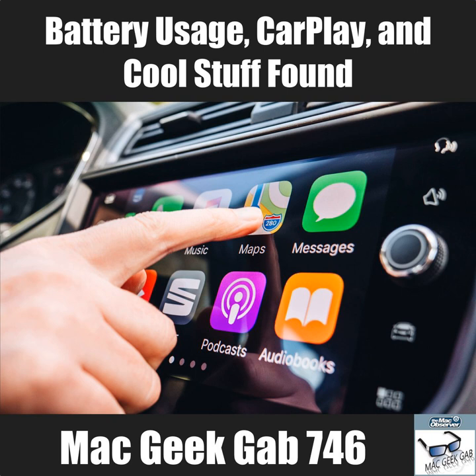Dave discovered an issue: the phone will not connect to CarPlay if it has an active Bluetooth connection where it's sending lots of data. It waits until that connection finishes. On short drives, CarPlay would sometimes never connect even though the phone was plugged in, because it never finished the Bluetooth sync.